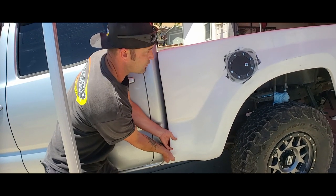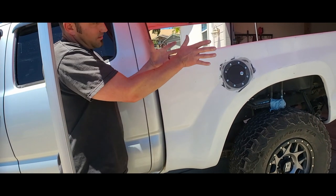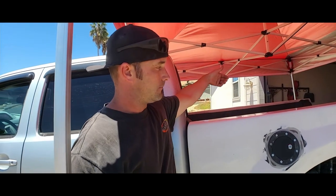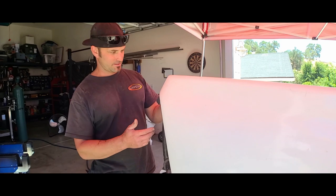Flexing the fiberglass shows we may need to trim the bottom piece touching the cab. Make sure your fitment is straight here because it tweaks the whole cab. The long story short: before you make your holes for bed rails or any mounting hardware, make sure your bedside is exactly where you want it. It could really affect the end-to-end fitment, the cab gap, or the light alignment. The bottom mounting brackets on either side of the tire can be finessed to wherever you need.